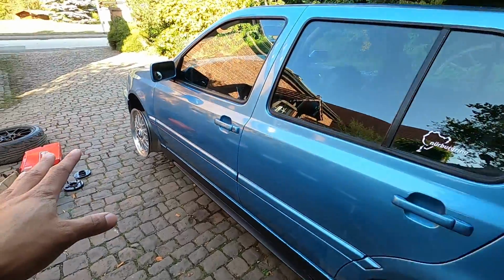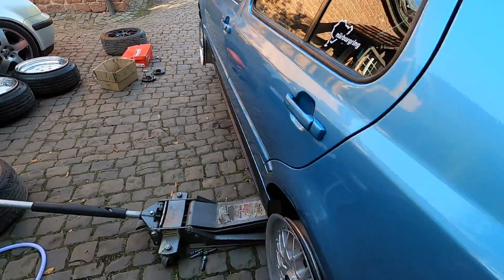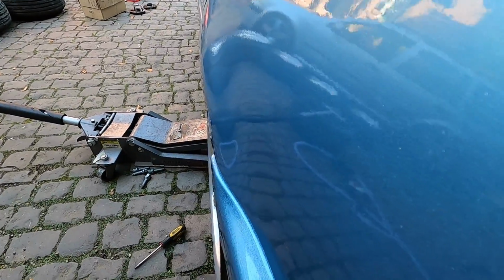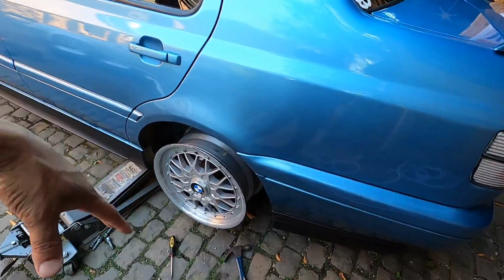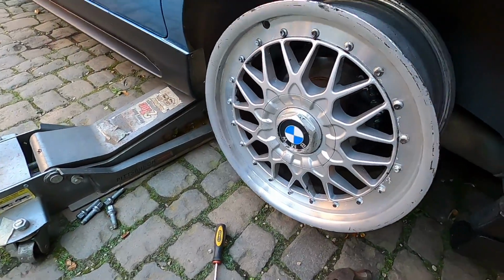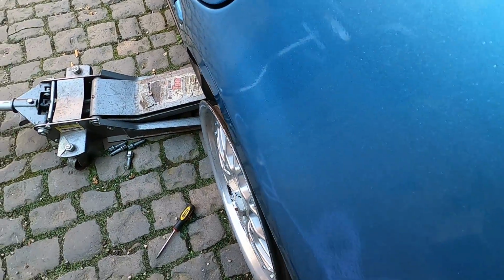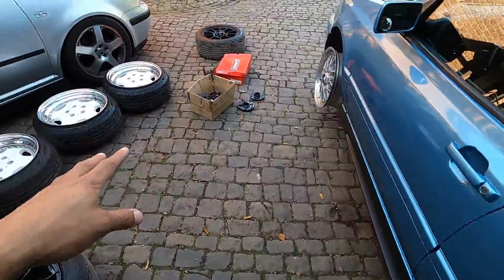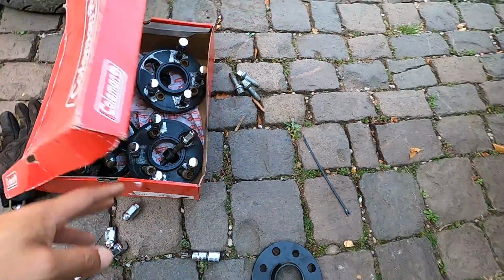Now the front, like I said, we can probably do maybe 1.5 inch, maybe 2 for luck. But the rear is way more sunk in. You can see that because in the back of my car, I have the Mark II rear beam, which gives you an extra 12 millimeters on both sides because I had to fit the Zaubers in the back a while back. So we have more space back here. So right now I have a 25 millimeter massive spacer, and these ones are still sunk in. So my adapter for the rear of the car is 18 millimeters. The fronts are 20s, the rears are 18s.